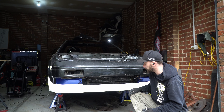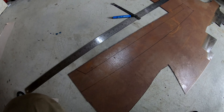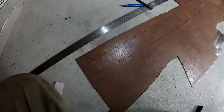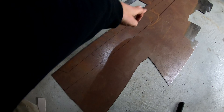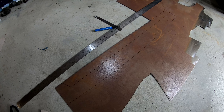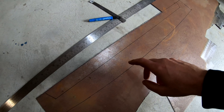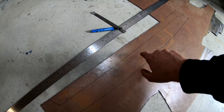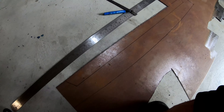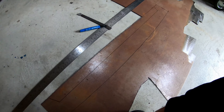I'm pretty happy with that - it's all sitting now. The edges where it joins up are not bad. It's never going to be perfect, it's an aftermarket lip, I think I'm doing all right. Now I need to drill the other holes - I want two holes either side holding that on and that's going to make it nice and secure. I really don't know what I'm going to do with this strip yet - we'll just have to wing it. I've kind of got this plate sort of designed up - I'm going to cut this out and run a fold along the edge with the bead roller just to strengthen it.